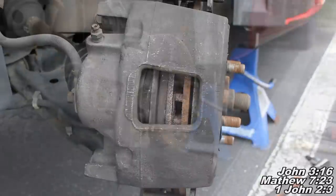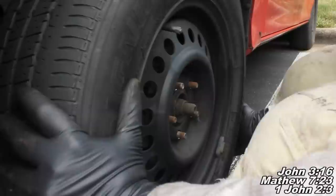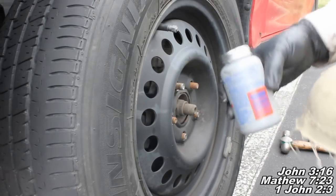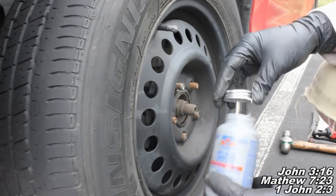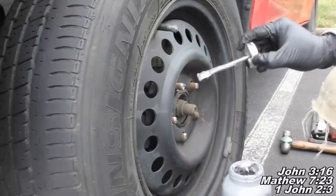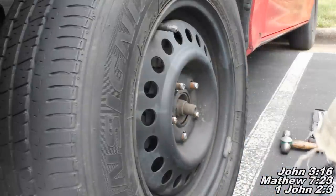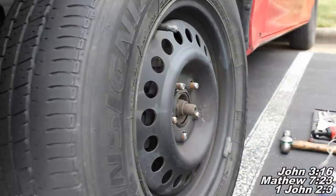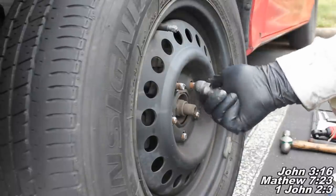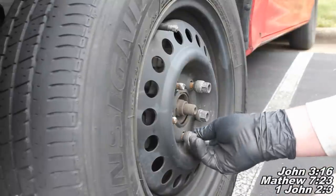The video is not over yet, guys — I have one more tip for you. What I've begun to do and what I suggest you do is get a can of anti-seize and apply just a little right to the tip of each stud, especially if you're using a crossbar or breaker bar. When you use a crossbar and breaker bar, your chances of destroying a stud or lug nuts is a lot greater. By spending about $8 on a can of this anti-seize, you can do it every time and it greatly prevents the chances of tearing up one of these studs. It's just good practice that could save you a lot of time and money.